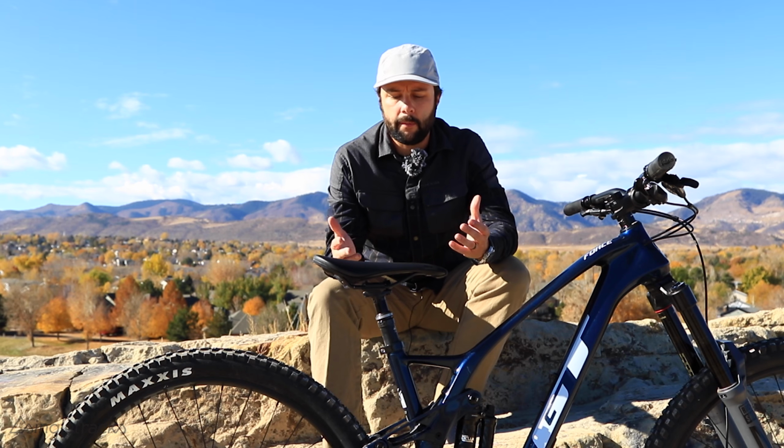And kind of the negatives when you're working with Enduro bikes and a lot of long travel bikes is that you're trying to increase the anti-squat, make it more pedalable, make it more of a climbing platform, because that's what Enduro riders and Enduro racers need. And the consequences of that are often pedal kickback. And then you also get a lot more chain growth when your suspension compresses.